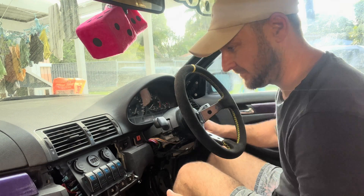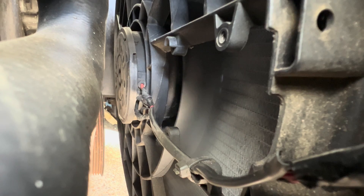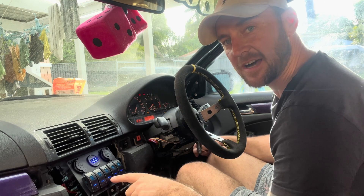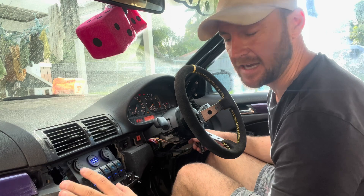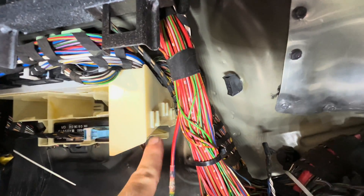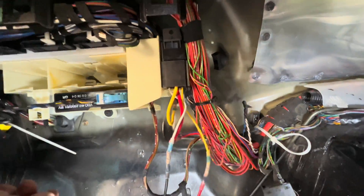Moment of truth — power on. Yeah! Hear that? That's the fan. We've got our lights too. That's awesome — we know it all works. Now we just have to tidy everything up: all the wiring, mount the relay, and do the cover for this. I was looking for somewhere to mount the relay under the dash, looking on the side of the fuse box, and they've got these little slots up there which look like they mount some sort of relays. My store-bought relay slots straight on there — winning!